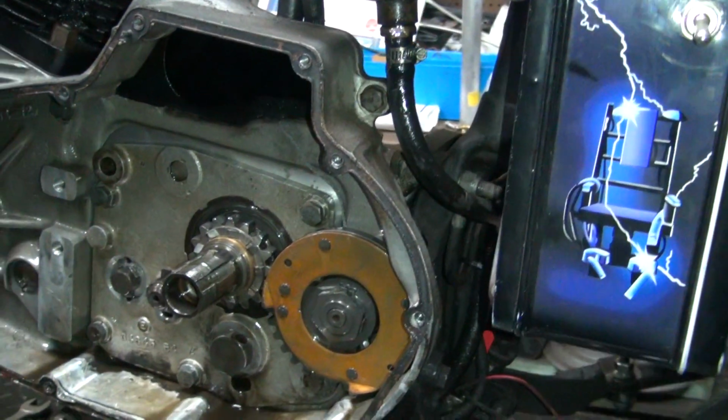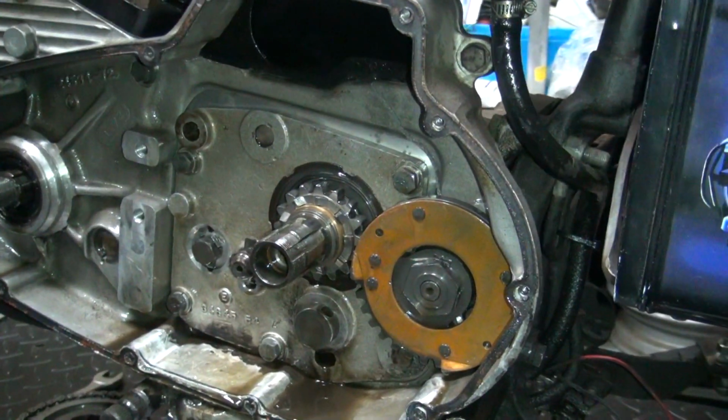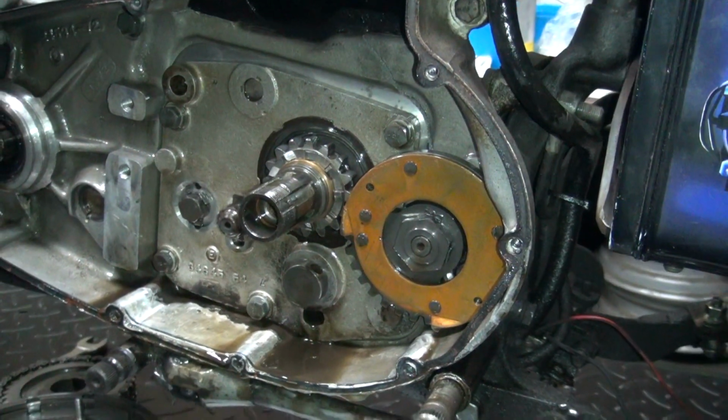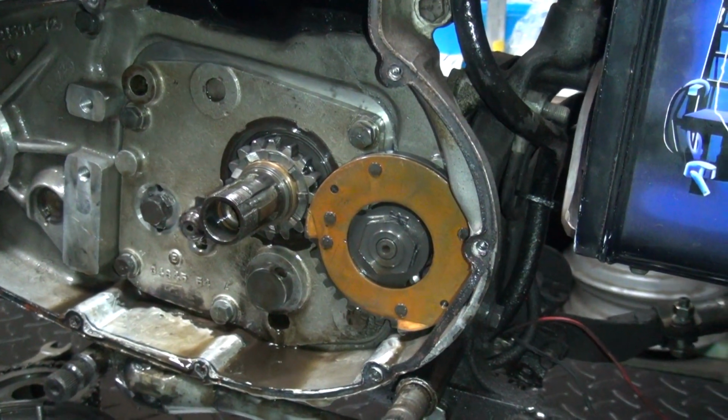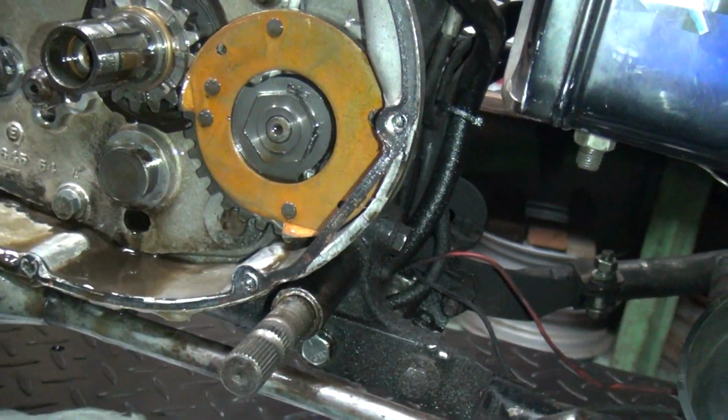I can see that. When I was kicking it up, it would miss, and I actually stretched out my knee a couple times. Oh. Yeah, it kept jumping. I told you, you got to go all the way through and hold it. Remember I told you that? You gotta jump. It looks like the kicker broke, not the tranny.